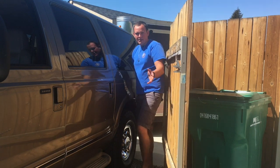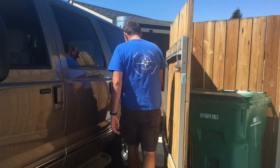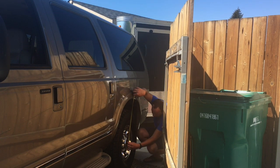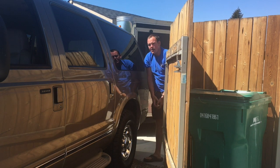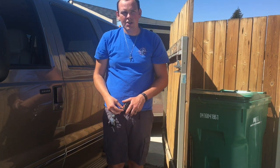Okay, so now as you can tell — I'll step out of the way — I got the truck fully loaded with the trailer. Let's see where we were at. We were at 23 and 3 quarters, and now we're at 22. So this thing dropped an inch and 3 quarters with the weight of the trailer.